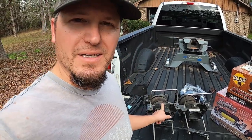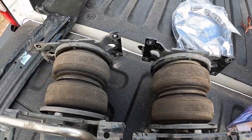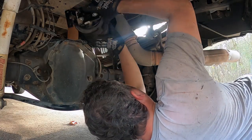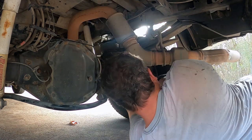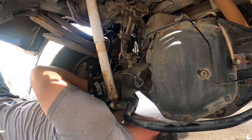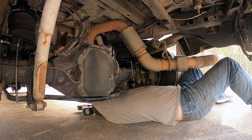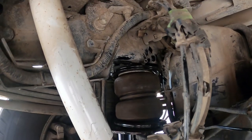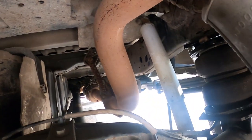The first thing we're going to do is install these airbags. These came off my truck because we upgraded to the 7500s, but these 5,000 pound Airlift 5000s will be just fine for his camper. We have to remove the factory bump stops and install the upper airbag plate. We now have the airbags installed — there's the driver's side and there's the passenger's side.